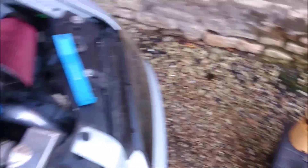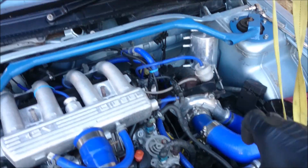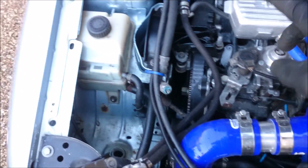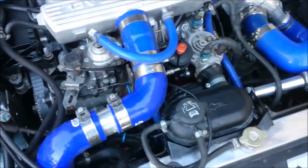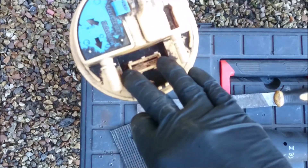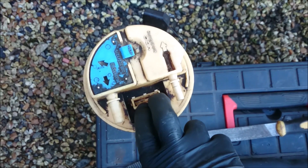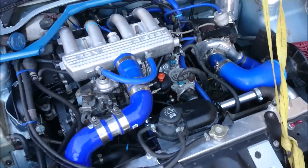The plan is to run some fuel lines — first job is to fit a bracket, fit the swirl pot on the bulkhead. That's why I've had to move some of the Arduino control stuff, which we'll move across. Then run some fuel lines through the car and plumb it up to the fuel filter. I want to leave the original lines there so that if it goes wrong we can revert back to the old system. I've already checked the wiring inside the car — it's got a positive. There are two pins: the outer pins are for the fuel level which runs off the float, and the inner pins — one's earth and one's a 12-volt live constant. We're going to put it on a little switch so I can control it myself. If there are any problems I can switch the fuel off — it won't stop the engine but it'll stop fuel flowing — a bit of an immobiliser function.